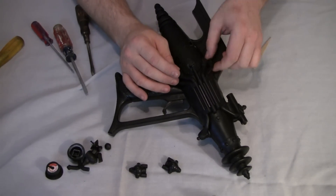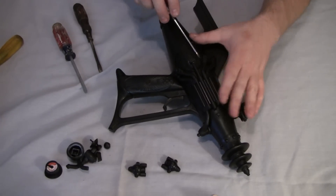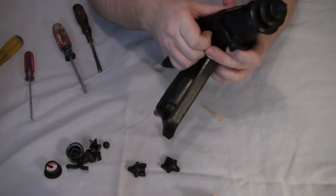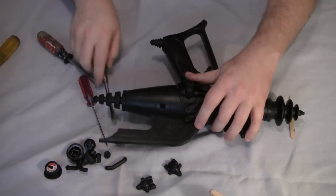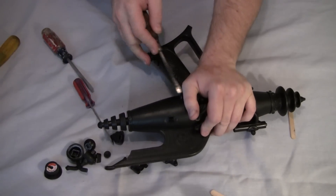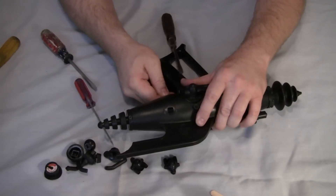I've actually hit some of this with a heat gun — it's helped out quite a bit. It softens these up a little bit and makes them nice and gooey. I had it on a low setting and just tried to evenly warm up the area I was working on, and I was able to get all four of these tube ends released, and it's still pretty warm. I was able to spread this apart and I can see the body halves cracking apart. I'm going to get my little screwdriver in there and run that up the seam.